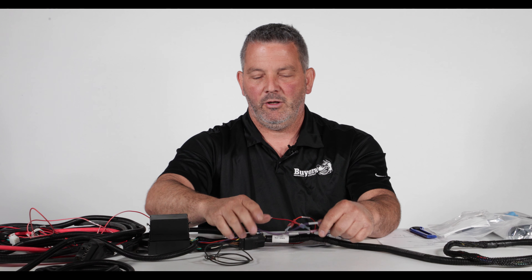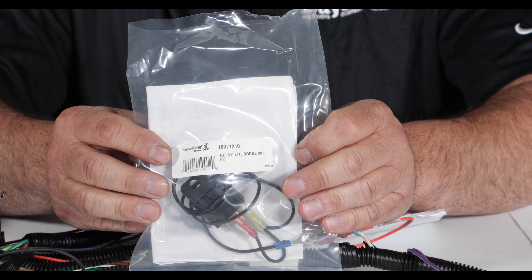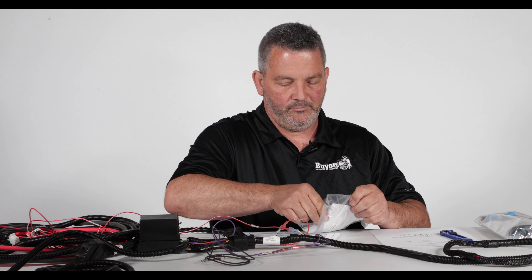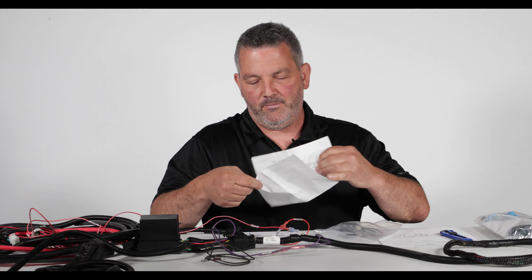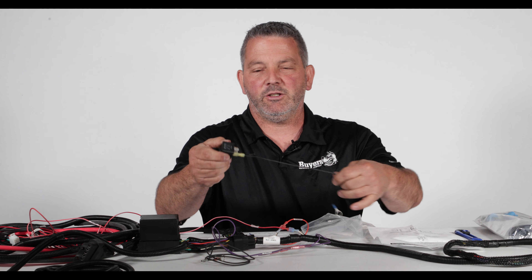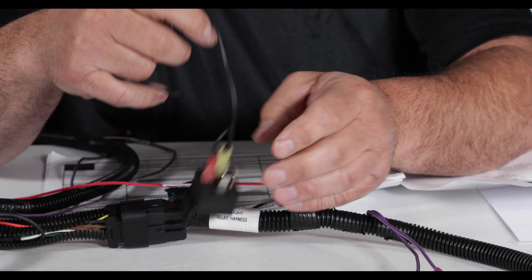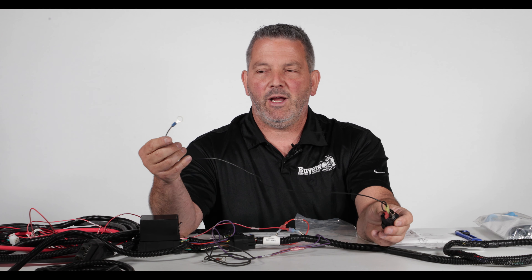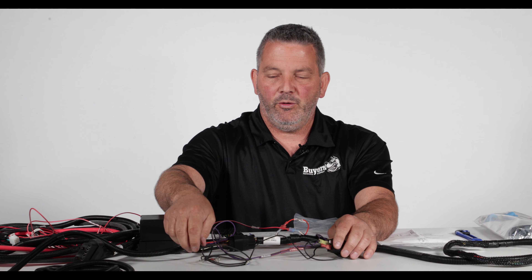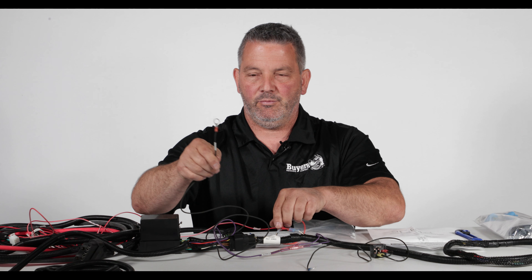Peel back the loom — it's about two inches away from the connection — and what you're looking for is a white with a black tracer wire with a spade connector on it. The spade connectors are kind of blue, nice looking. You'll find it really quick. What you want to do is separate them, so you have a wire going back to the relay box and a wire that goes out to the grill. Take your orange wire coming from the relay box and attach it to the wire that actually goes back into the relay box, so you're looping it back in. Then take the power wire coming from the control harness, which is part number 16-0302 — the red and white wire that goes all the way back into the fuse box where you pick up your switch power — and connect that wire to the other side so that the power goes down toward the grill.